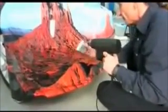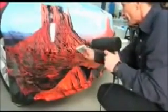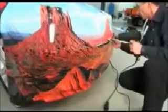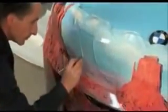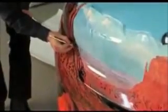It's recommended to look for flat surfaces and smooth the vinyl outwards from the middle, always after preheating it with a hot air gun. In this way, the vinyl is applied step by step to fit the vehicle's shape. Unwanted vinyl surfaces have to be cut off, bearing in mind the aforementioned procedure. The large concave surfaces of the spoiler have to be cut free. Now, the remaining vinyl is gradually applied, with the hot air gun and squeegee used alternately.